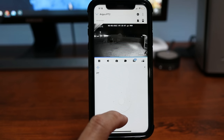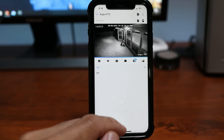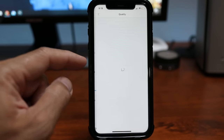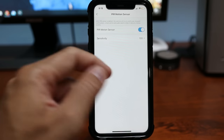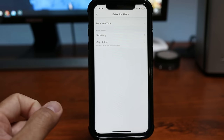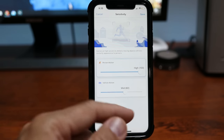With the joystick you can pan the camera left or right, but you cannot change the speed of panning and tilting. I noticed the tilting is way faster than the panning, which is not a good thing — you cannot slowly tilt the camera; it will abruptly move. On the top right is the siren button to manually activate the camera siren. In camera settings, video quality is set to 2K 2560 x 1440 at 15 fps. On the PIR sensor you can adjust sensitivity up to 100. Because it has AI, you can crank it to the highest and still not get false notifications. Detection zones and sensitivity can be set separately for humans, vehicles, and others.